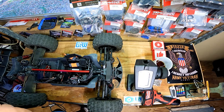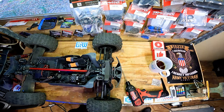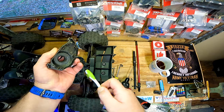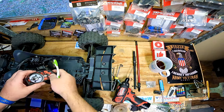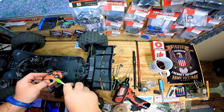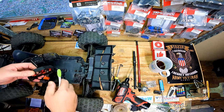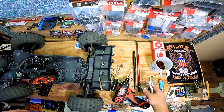I'm just real bad about not greasing that gasket. I need to open this up because if it is full of fluid then I know I need to run something thicker. I've only run this vehicle once — once — and there's a ton of sand in here, there's like a lot. So that's not good. Man, look at this — that's a lot of dirt. That's here with the gears. I might just put some tape or something over that hole because I just don't see any benefit of the gear sticking out like that.